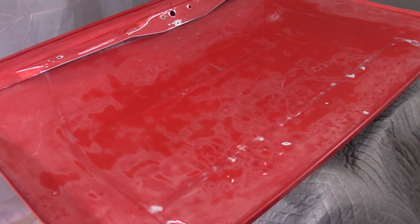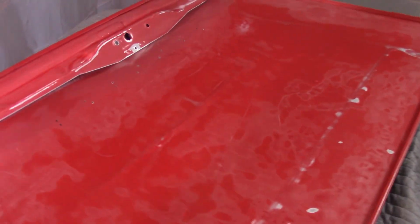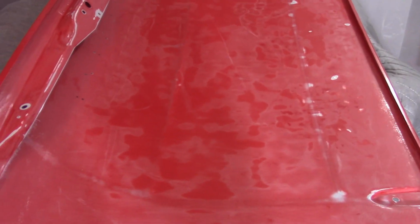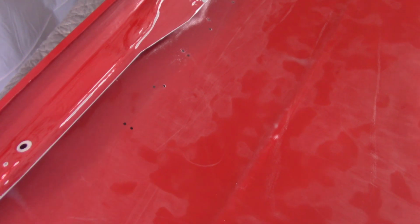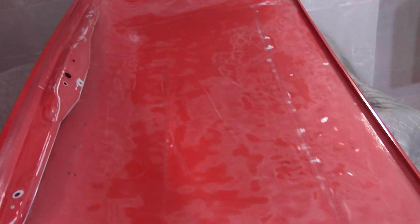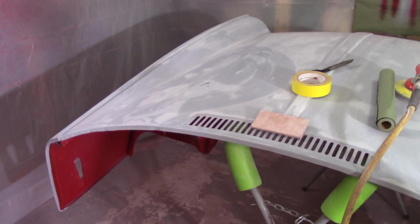Got everything on the inside sanded down through 220. I'm going to leave it at that. I'm not going to hit it with a scuff pad. Now I've got to go around and tape off all the edges, and I'm going to tape off the entire other side of it in paper, and the places where I don't want the tape to bleed through or the paint to bleed through, like, you know, the letter holes and things like that. And go ahead and get it taped off in preparation, and then move over to the bonnet here and get the bonnet taped off in preparation.